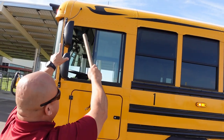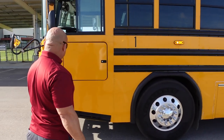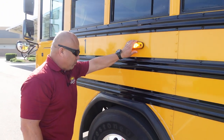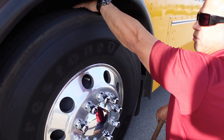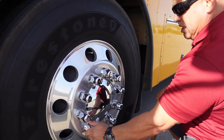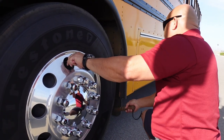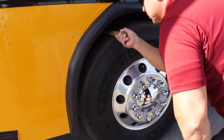Coming to the right side, starting from the top: all clearance lights are working properly, glass is clean and free of cracks, reflector is intact, panel is secure, bus 1 labeled properly. Side mount signal — there's no damage and it's working properly. Wheel well cover is secure. Checking for proper inflation. Tread depth minimum in the front should be no less than 4/32 of an inch in all major grooves. No cracks or bubbles, rips or tears in my tire. Checking for loose lug nuts — indication would be cracks or rust; there's no cracks or rust. No cracks, dents, or illegal welds in my wheel. Valve stem is secure. Mud flap is secure. I have a visual on my leaf springs front and back. Also checking for foreign objects in my tire.